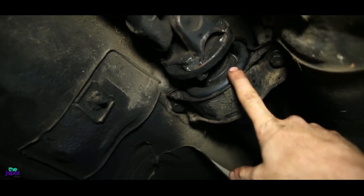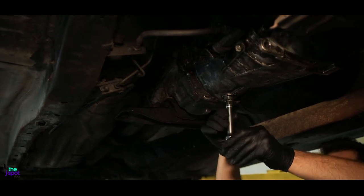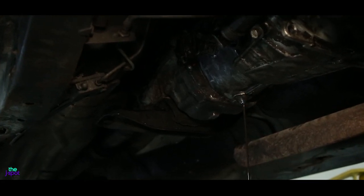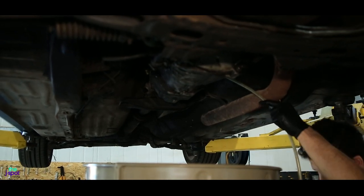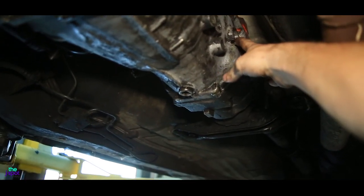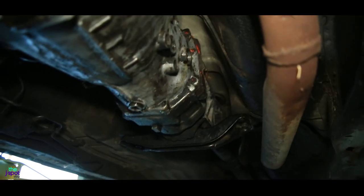We've changed the main drive shaft bearing — it was completely shot. Now it's in and it's really solid, not moving anywhere. Let's see if there's any oil in this thing. There is oil in there, not very much, but he's got a vacuum pump and he's going to pump it into the gearbox. You can see the bung up here that you take out to fill up the gearbox oil. It's leaked down the side which indicates it's full, so we put the bung back in and wipe up the gearbox.